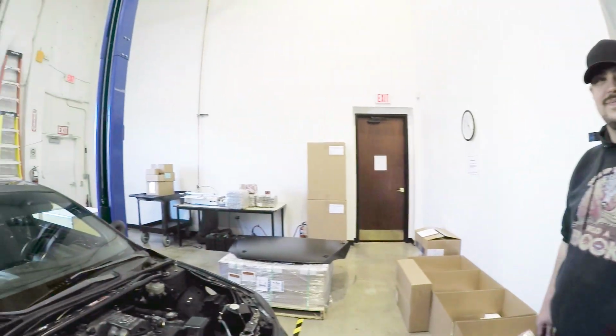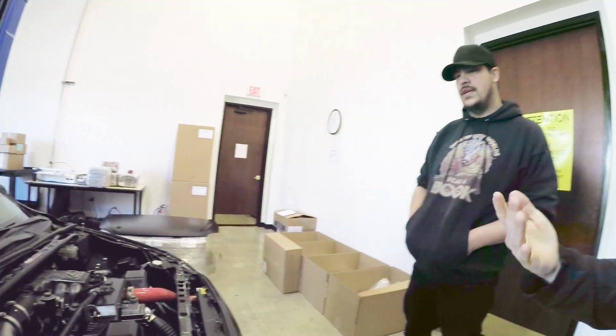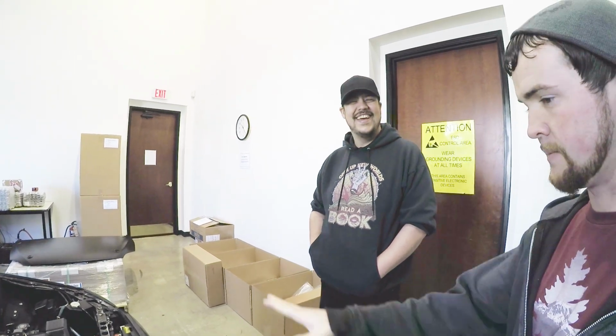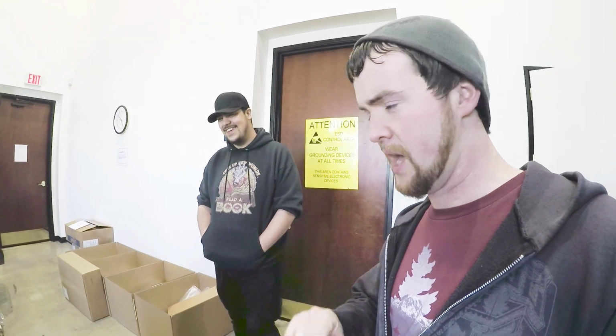Gotcha. And then I guess the next question would be, what sort of suspension in terms of parts, like what shocks and springs are you running, to make this all happy? So it's got the subframe of an LS400 in it, which we'll get on the lift and go over. But it's set up weird, so I had to redo how the sway bar is mounted. The knuckles are actually from a V6 Camry.